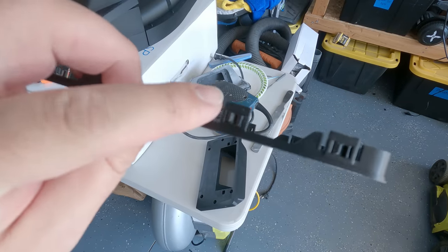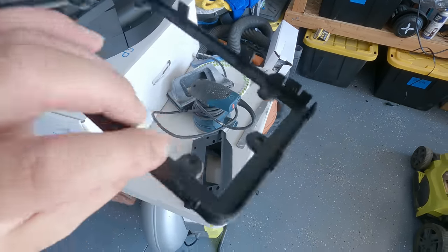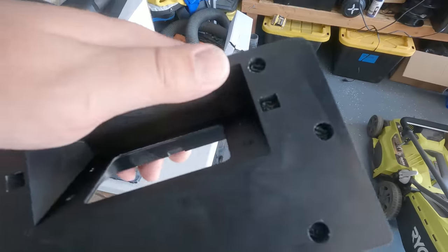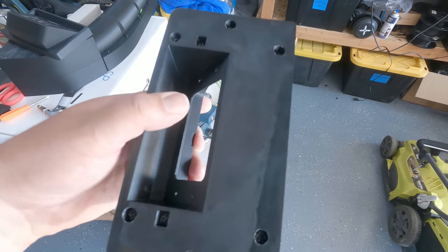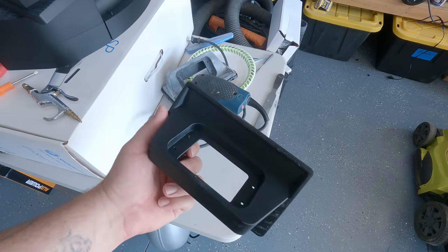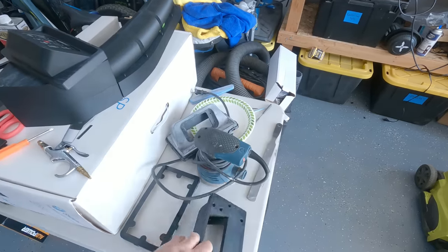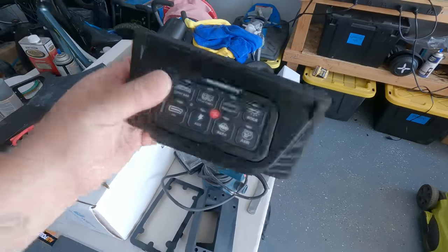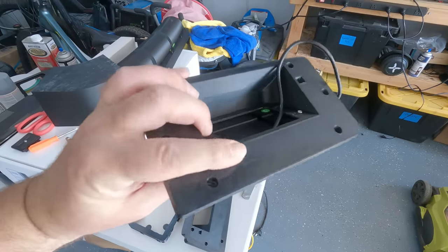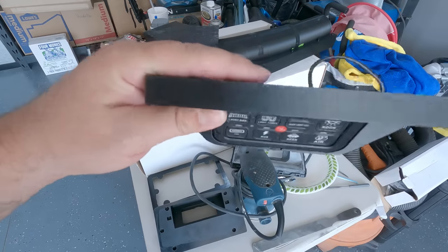I created a separate piece with all those tabs so I can really isolate and get the supports right for them. There are holes that will actually bolt to the bottom of the panel using threaded brass inserts, so I can mount the two together - hopefully with a lower failure rate. When I went to test it in the truck it sat too low and obstructed the view of the rear view mirror, so I redesigned it again with the same mounting tabs but a shallower angle.